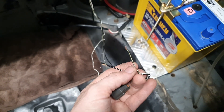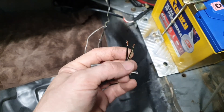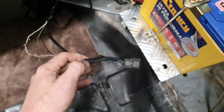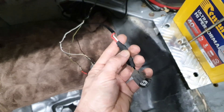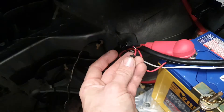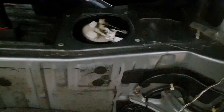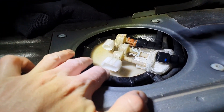And then also when cranking, and obviously when driving. At the track, what I had to do was cut this connector and just married it up as best I could with what I had at the time - just hardwired it to the battery with a fuse, negative and positive straight power supply to the fuel pump. This is the fuel top hat for the fuel tank.